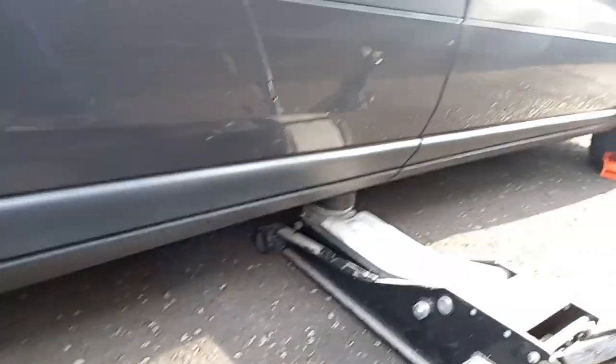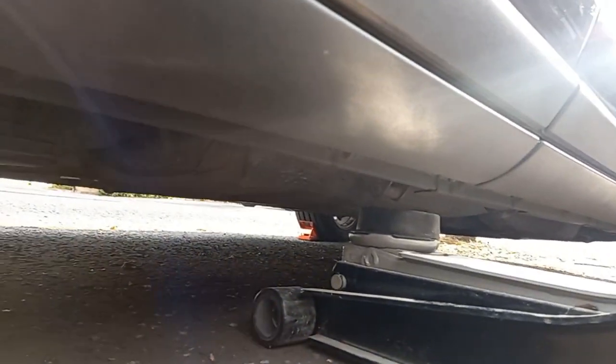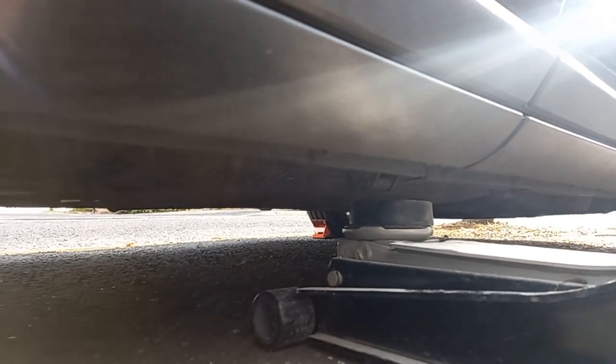So of course safety first - handbrake's on the rear wheels, need to chock the front wheels. I'm using a trolley jack but you really don't need to. I'm actually going to be using the trolley jack on the connection point for the jack that comes with the wheel change kit, so you could use that just to get it up on axle stands.